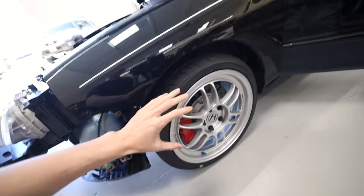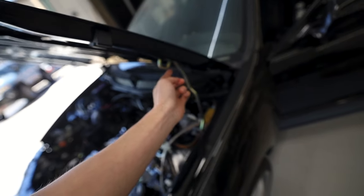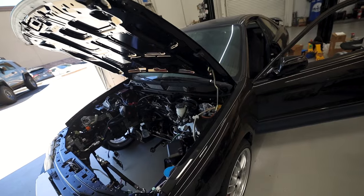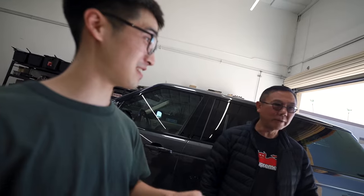You can see everything on this car has been zinc plated — even this piece, which is zinced OEM. This finish is called chromate. When you do zinc plating, it comes out silver. After the zinc coating, they dip it in a chromate solution to turn it that gold color. There's actually a plating shop just down the street that can do that — which is awesome.